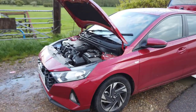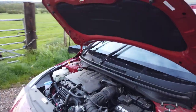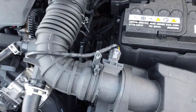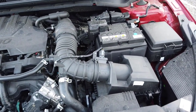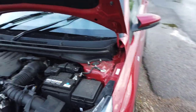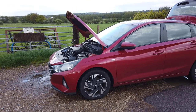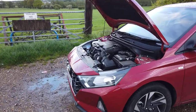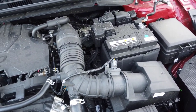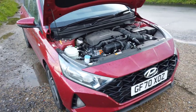This vehicle is also equipped with what Hyundai calls an intelligent manual gearbox. It's technically a manual gearbox with a couple of sensors — speed sensors and a gear selection sensor — so the gearbox and ECU know what gear the lever is in. It goes into a sailing mode when you apply the brakes and coast, turning off the engine to save fuel.